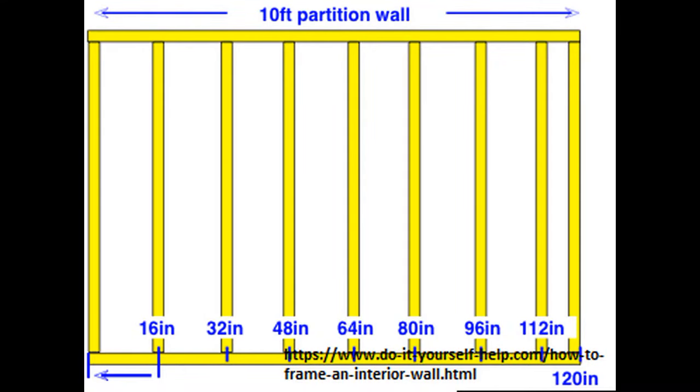I would want the box tubing to be on 16-inch centers. Most sheet aluminum or plywood is 48 inches wide. With 24-inch centers, you're only going to get three studs in 48 inches: one at zero, one at 24, and one at 48. With 16-inch center studs, you get one at zero, one at 16, one at 32, and one at 48 — an extra stud for every four feet of trailer length. It adds a little weight, but it's going to be a lot stronger trailer.